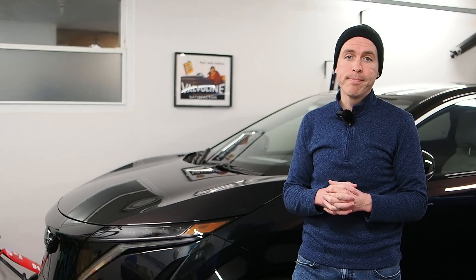For those who may be new to EVs or just don't know, cabin preconditioning is what you should do in the winter especially, but you can also do it in the summer, to either heat or cool the cabin of your EV prior to you getting in. It is one of the great benefits of having an EV — being able to get into a comfortable car no matter what the temperature is. The main reason you'd want to do that on an EV is the EV is supposed to pull power to condition the cabin from the grid when you're still plugged in at home, so that way you can start out with a full battery, have a comfortable cabin, and maximize your range when you're out on the road.